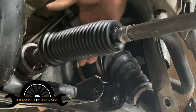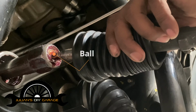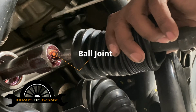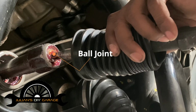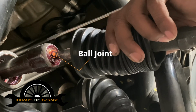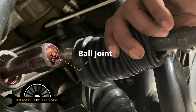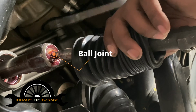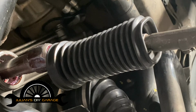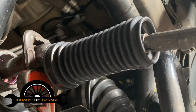Okay, we can move our boot back, and can we see this is our ball joint? Sometimes, and again, different vehicles have different types of parts, sometimes they're just smooth, but if you can see that there are ridges or platforms, almost like a socket, this is what I'm saying. We can put a pipe wrench on here and loosen it, or I'm going to show you what I mean by that. Let me reposition myself. Pipe wrench, follow me, and loosen it.